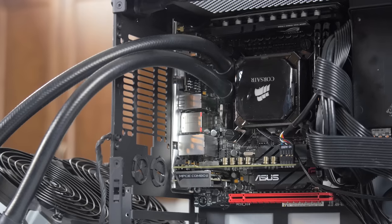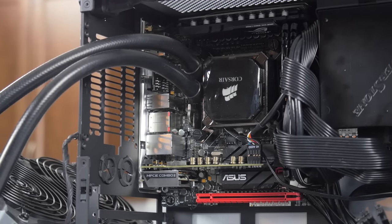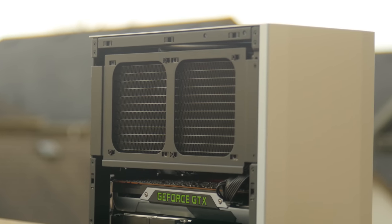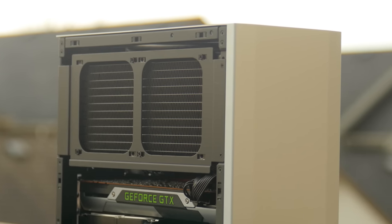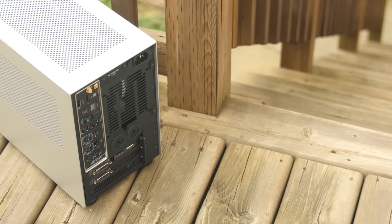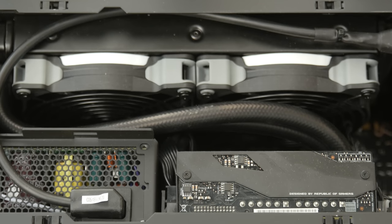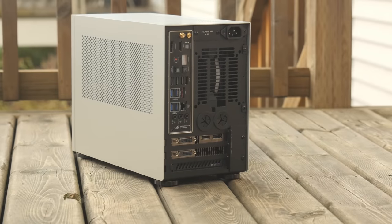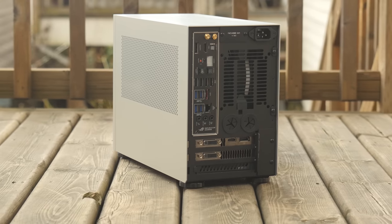While we're looking at the power supply, the top of the case is mostly taken up by the mounting bracket for it and this cleverly routed AC power input extension — giving a good look at just how little space was wasted in the width of this case once you fill it with hardware, especially if you go all out with an ROG board with that beefy daughterboard-mounted power delivery solution and 3/8-inch tubing on your AIO CPU cooler. Had I not opted for a dual 120mm radiator, there's a bracket that holds up to two 3.5-inch hard drives where the forward radiator fan now sits.